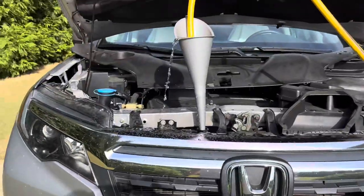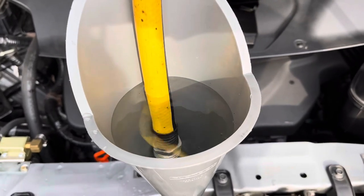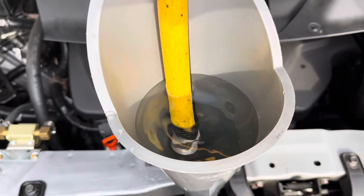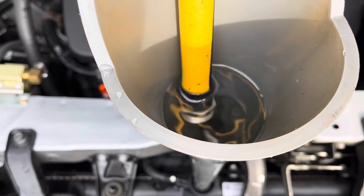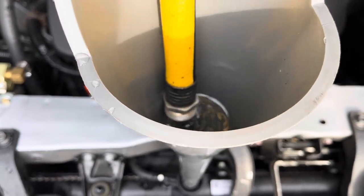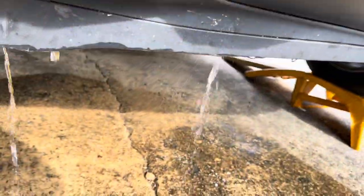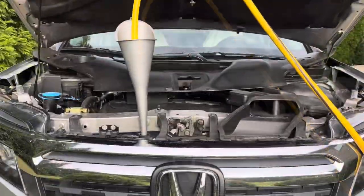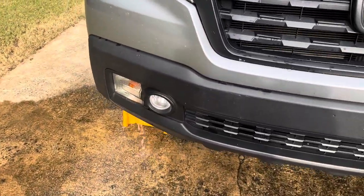It won't last long, I'll turn it down. Sorry about the wind. It's interesting — you can see exactly when the thermostat opens, the water level just drops like a rock. There it goes, thermostat's open. It goes down, and you heard that gurgle up there, and it gets hot because it's cycling through the engine. All right, this engine is hot, the fans are kicking on and off, thermostat is cycling more and more often.